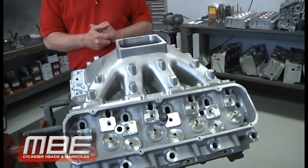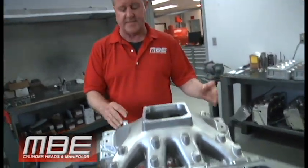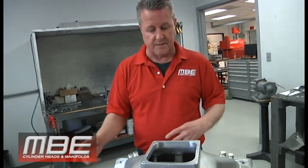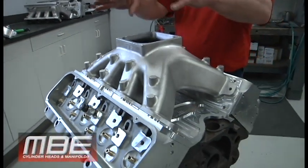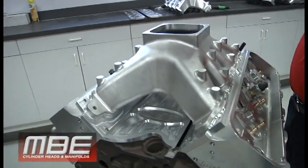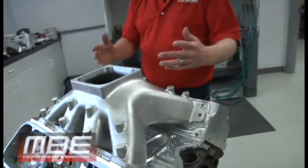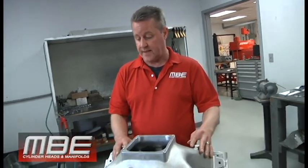There's a lot of power here. I really think some of the intake manifolds available for the A460 are just not correct. We have dyno tested this many, many times — the power is substantial, especially for guys in the truck pull class running 500 cubic inches anywhere from 9,200 to 10,000 RPM. It doesn't fall off on torque; you don't have to run a bunch of jet because the plenum volume is correct, the runner size is correct, and it's not just a huge manifold that's 15 inches tall. At 500 cubic inches it still needs to make torque, especially for truck pullers or drag racers.